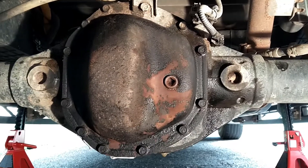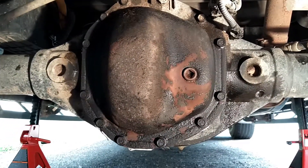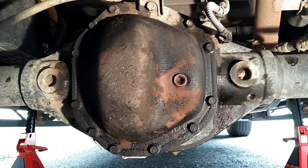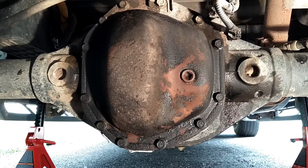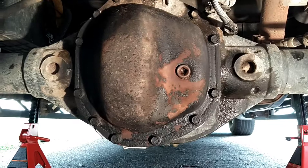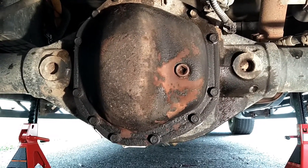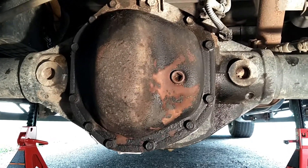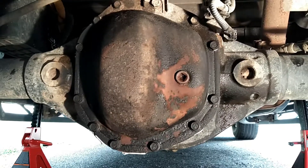But we're here to put on that armor plate. I took some Simple Green and cleaned up the diff cover a bit because it was looking pretty rugged, as most things underneath the truck usually do. While I was in here I noticed around the bottom edge some RTV sealant has actually escaped around the edge a little bit, so I'm wondering if the dealer at some point might have resealed this diff cover. From the factory sometimes they do have a bit of seepage. Nissan's definition between leakage and seepage are two very big and different things — leakage they will warranty, seepage they don't consider a big deal. It's really not a big deal: you take out 12 bolts, pop the cover off, put some new RTV, and put everything back together.